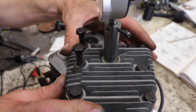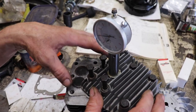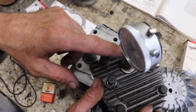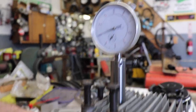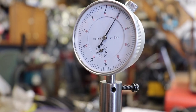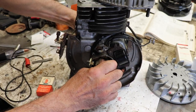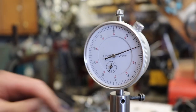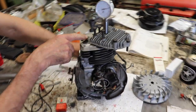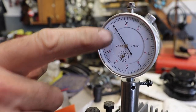I have a dial indicator and a regular spark plug tool. Since the spark plug hole doesn't line up over the top of the piston, you need to find a hole in the head that'll line up so you can position the dial indicator over the top of the piston. You're going to want to zero your gauge and find where top dead center is. I already pre-zeroed it. Then we want to go 35 thousandths before top dead center, so I'm going to start bringing the piston down: there's ten, there's twenty, there's thirty — five.